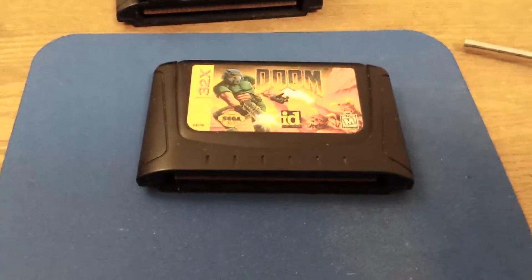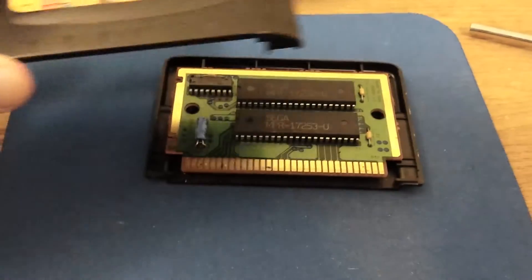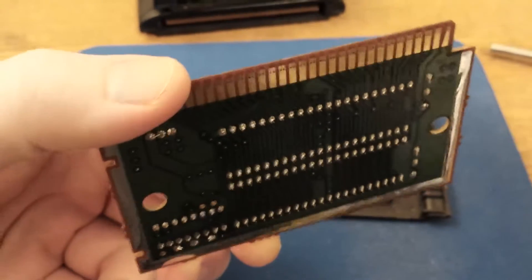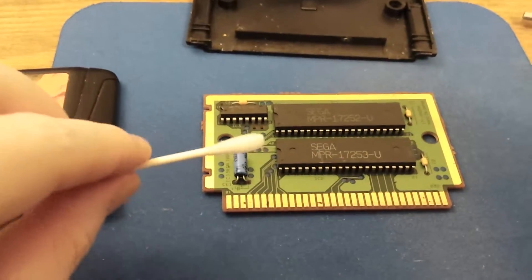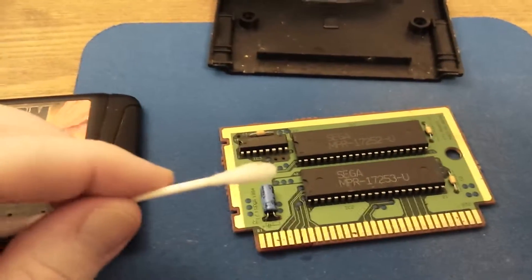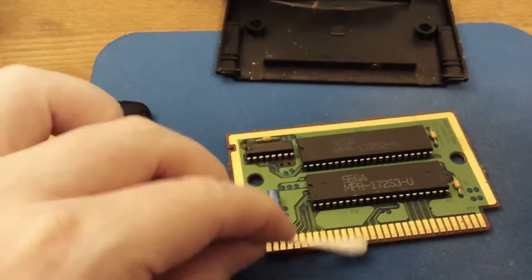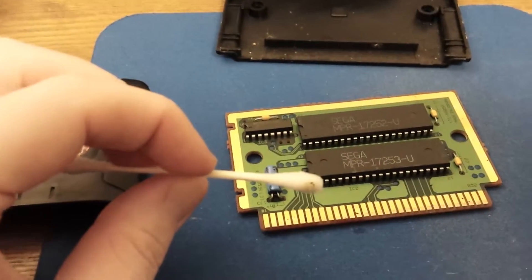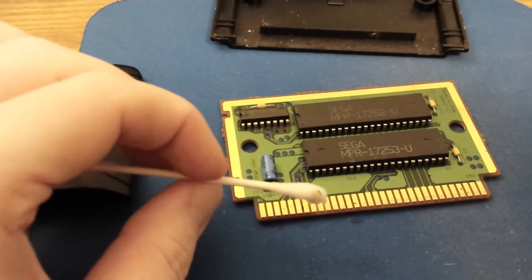The screws are off. The lighting looks a little different because I put down a mouse pad to work on just to help protect the cart. Screws are removed — I'm going to pop this off and this is the game inside. It doesn't look too bad from here, but it's definitely dirty and needs to be cleaned. Just take an ordinary Q-tip, put some rubbing alcohol on the end, and swab the connections, applying some pressure in a downward motion. You can definitely get some dirt off — I can already see it coming up. I'm going to finish up and get this all cleaned up and put it back together.